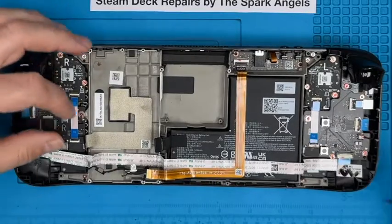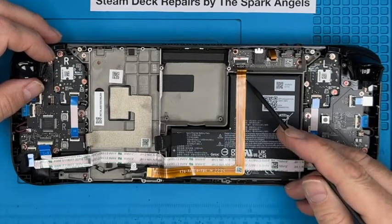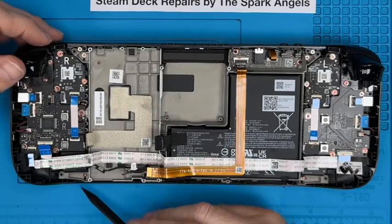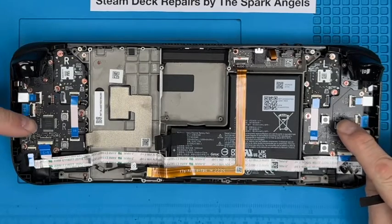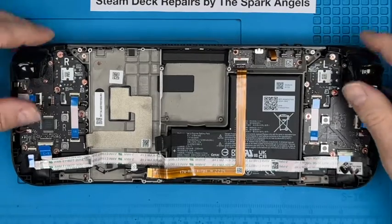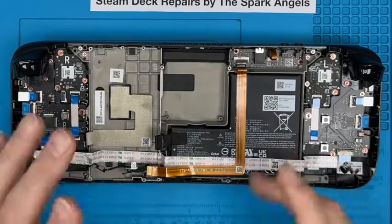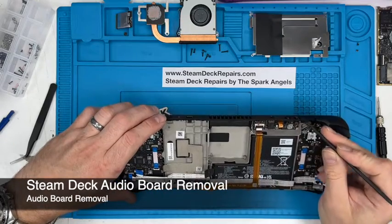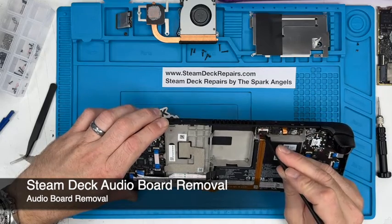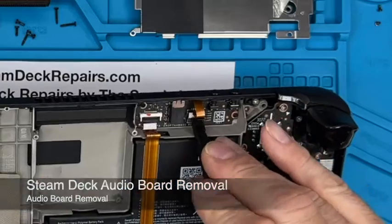So, next thing you can see, you've got the daughter board cable goes on there. Audio FPC cable up to there. That's the LCD cable. 2 daughter boards that they call it. Thumbsticks. And then all the button, everything, and then the 2 speakers under here, and you've got the main battery there. So we'll take the audio board out there. It's got the up and down volume buttons, the main connector in, the headphone jack as well. So we're gonna lift that up.